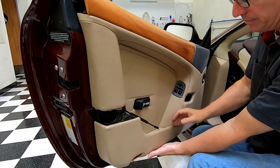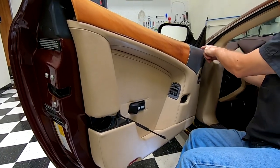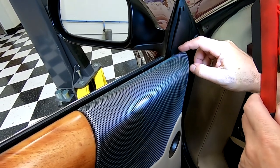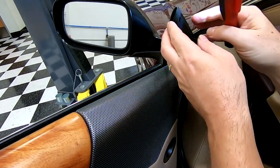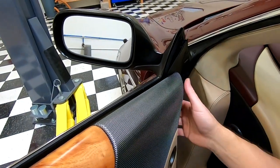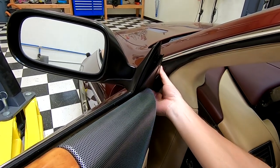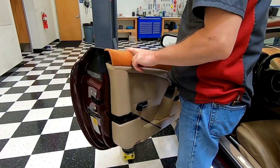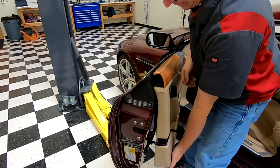So we're almost ready. The process is we're going to pull the door card out at the bottom and then lift it up. There's one last obstacle: when we lift this up, it's going to want to scrape against the mirror trim plate. The manuals say we should remove this — it's just held on with clips and we should just be able to pull it back. So now there are basically three clips or three little arms it's resting on top of. I'm going to pull back at the bottom and then lift the door up.